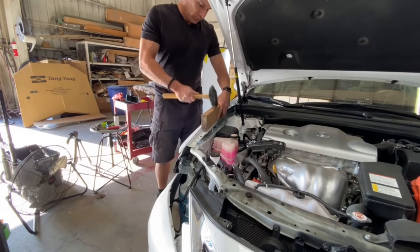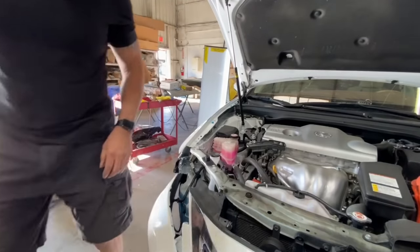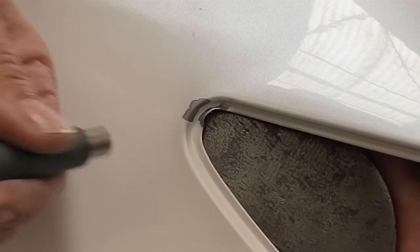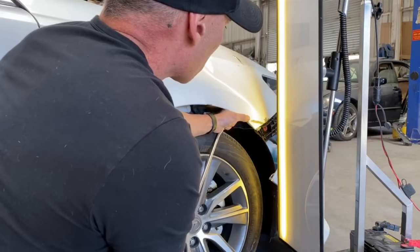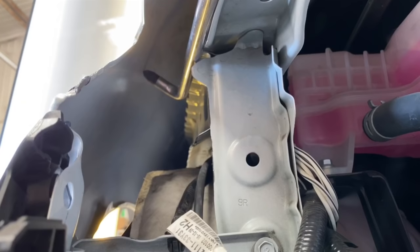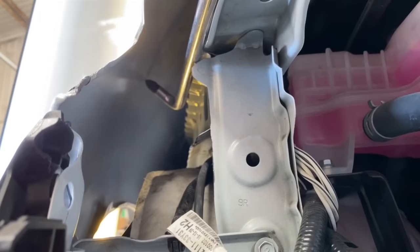I'm going to use a 2x4 as a knockdown and give the top fender a few strikes. Next, closing the hood to check the alignment and the gap. Going to clean up around the headlight. Placing the body repair dolly up against the edge. Using a sharp Delrin tip on a paintless dent repair rod — this panel has a lot of micro lows and highs that I will need to fine tune with my remaining rotational PDR tools. I will make a series of pushes from the back side and a series of knockdowns on the front side.